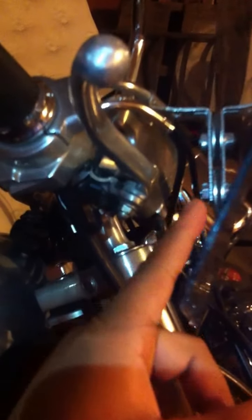The way I attached it: I used screws, metal washers, and rubber washers on the other side — rubber washer, then metal washer, then the L-bracket, then finally the nut. Total cost was about $20. The sheet of Lexan was $20, but I'll be using the rest for a windshield for the motorcycle. So: screw, metal washer, rubber washer on one side; rubber washer, metal washer, L-bracket, and nut on the other. The rubber washers give it extra stability and cushion from being pinched too hard.